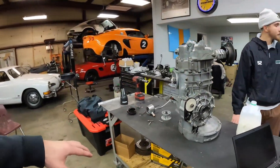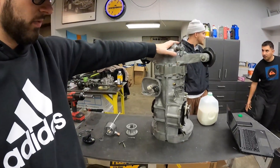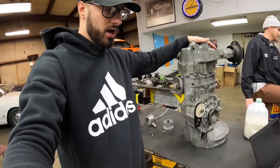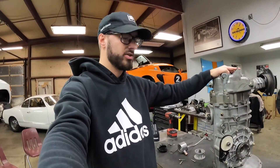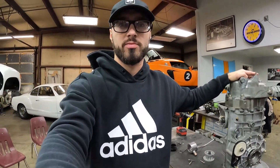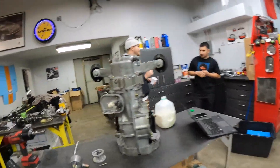Update on the transmission as well — transmission and gearing, everything is completely done. We even have a mechanical sensor right here to open and close the oil cooler for the transmission when it gets to 170 degrees. It will do it completely automated, so we don't have to tune that mechanically.